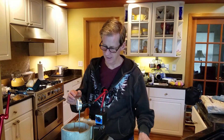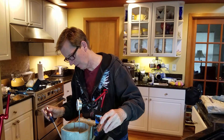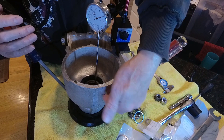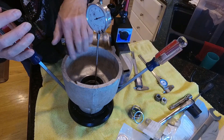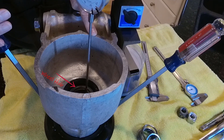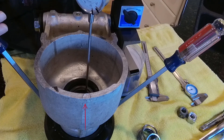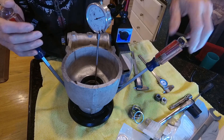First thing we're going to do — I've got this all set up. You take these two screwdrivers and position them opposite each other between the water ring. What it's going to do is move the carrier hub or housing. This test indicator is on the other end of the wheel hub. When I pry down on the screwdriver, if there's any end play the housing will go up and the amount will be indicated on the dial indicator. You want preload — end play is slop. Preload puts them together; taper bearings like preload.